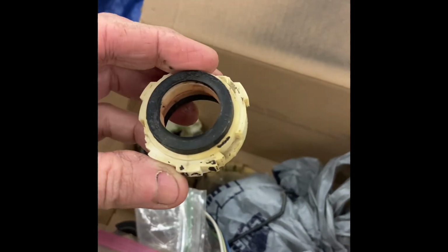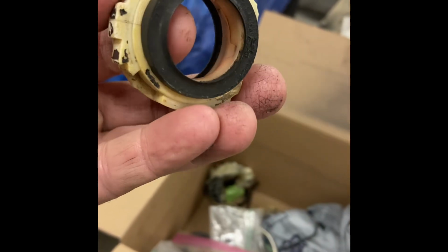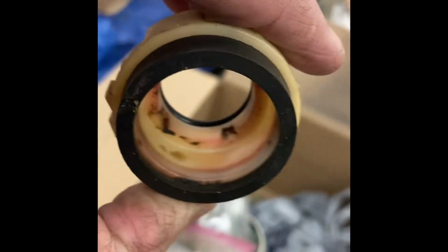And one thing that was confusing me, every time I looked for a kit, it said bearings for the bottom of the steering shaft. But in this particular one for the Firebird, even if I go look on eBay, it says for Firebird Camaro and it's got bearings. Well, apparently they don't. I guess it just rides inside there on the shaft because there's no room for any metal bearing or anything. Must just be like a little bushing. That's it. I just need a few pieces of springs and things, and I'm just going to put this other one together and probably sell it.